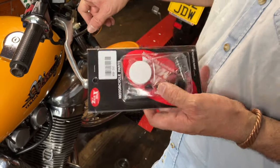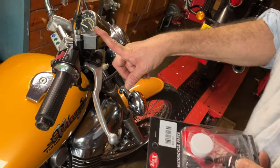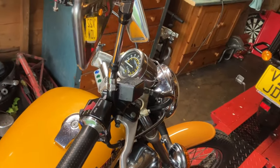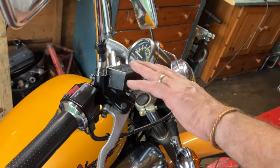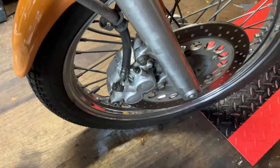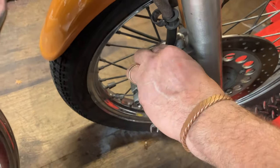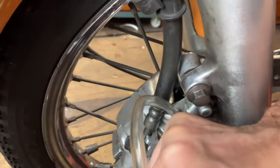What we're going to do today is put a repair kit in the master cylinder. So first job, I'm going to take the fluid out because it's always a funny angle. I'm going to drop it out of the caliper side, best I can. Nice little bit of pipe, 8mm ring spanner, and then just crack that open.